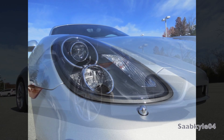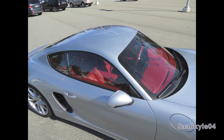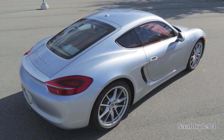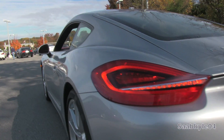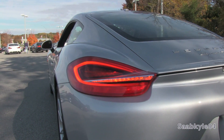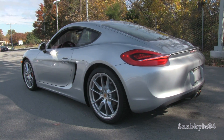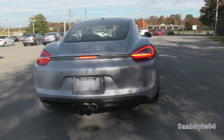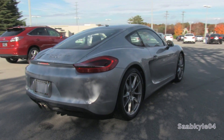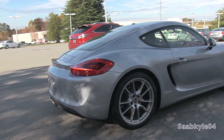The windshield has also been moved forward 4 inches for a better-balanced side profile. Torsional rigidity is already better for the Cayman over the drop-top Boxster, but it's been tightened up even more this year by 40%. The central structure is composed of a hybrid steel-aluminum monocoque surrounded by aluminum body panels. The monocoque was redesigned to save 103 pounds. Aluminum makes up the front fenders, hood, hatch, doors, and floor pans — about 44% of the body is aluminum. Even with some of the extra features for 2014, weight is still down a claimed 66 pounds compared to the last generation.